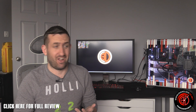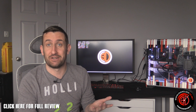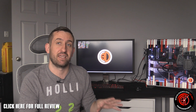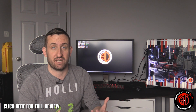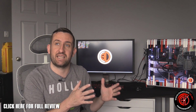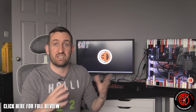1354 watts in itself. It's like, oh my days, did you really just pull that from the wall? So it's not a shy system at all. And the thing with the benchmarks is we can quite literally say that we are bottlenecking the CPU, and I hate that phrase. But it's just because we are at the limits of what the graphics cards are working to their potential. The CPU side of it isn't bottlenecking it in a sense. The CPU's doing all that it can, and rather than the graphics cards not being able to keep up, this time they're just running at their max.